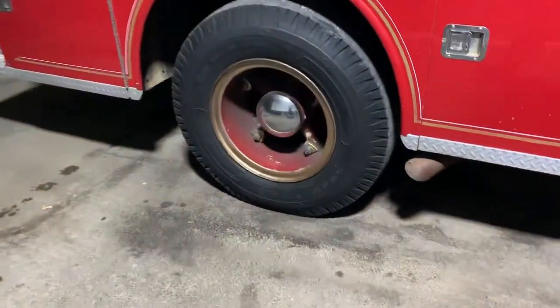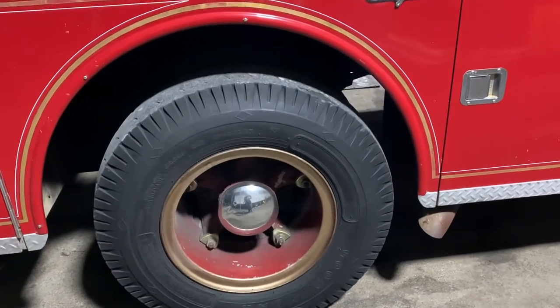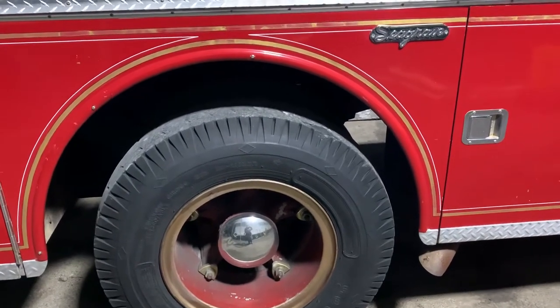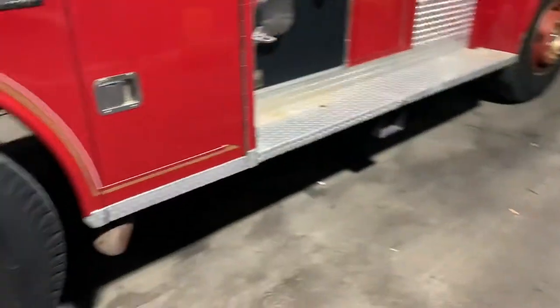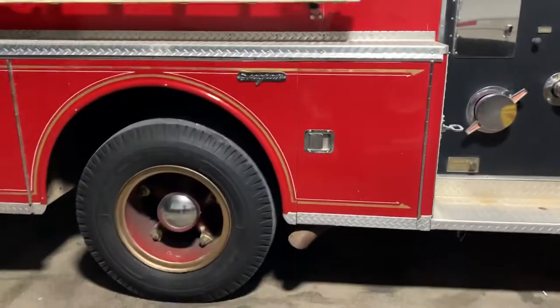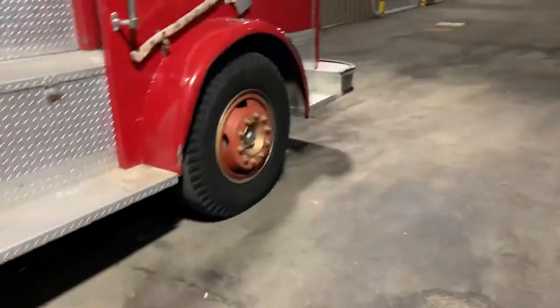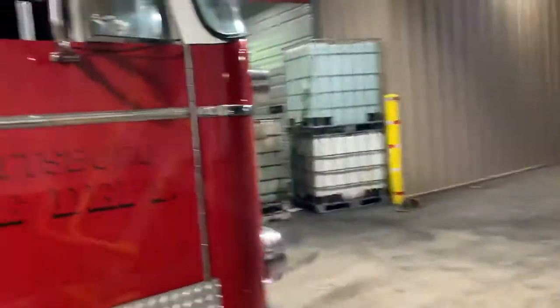In the near future I've got to get some tires put on it. These have the 1020 tires with the two-piece wheel — anybody that knows anything about these knows how dangerous they are. I found a guy that sells these tires for $125 a piece, but I'd really like to go to standard 22.5s, kind of like semi tires — a lot easier to find and not as dangerous. I can do it on the front because it doesn't have the wedge-style wheels. Whether I just put a regular set of 1020s on it or do an axle conversion just depends on the cost — when you get into big stuff like this it's money, money, money.